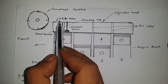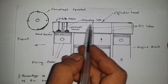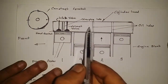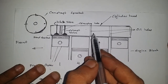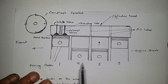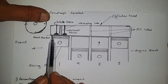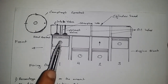In any event, if we are going to hear a leak coming from the intake valve through the intake manifold, or the exhaust valve through the muffler, or the head gasket, then to some extent that's still good news, because we only need to take out the cylinder head. However, if we're going to hear the leak coming from this area right here, above the cylinder head, that would tell us that the leak is coming down through this piston ring, through this cylinder sleeve, through the piston, down here, and upwards, up towards these oil holes. So if we're going to hear leaks coming from this direction, that would tell us that we have a bad seal on either the piston ring, the cylinder sleeve, or the piston itself, or a little of each.